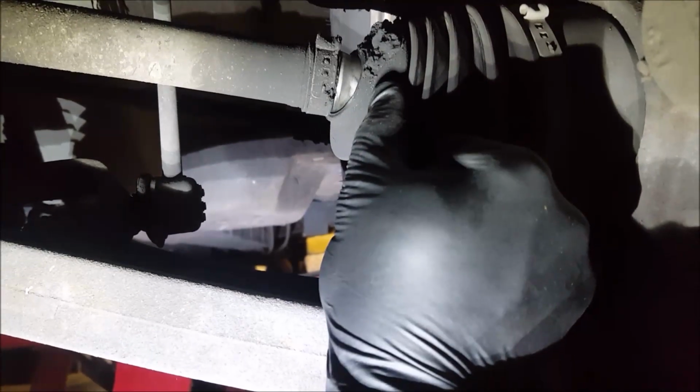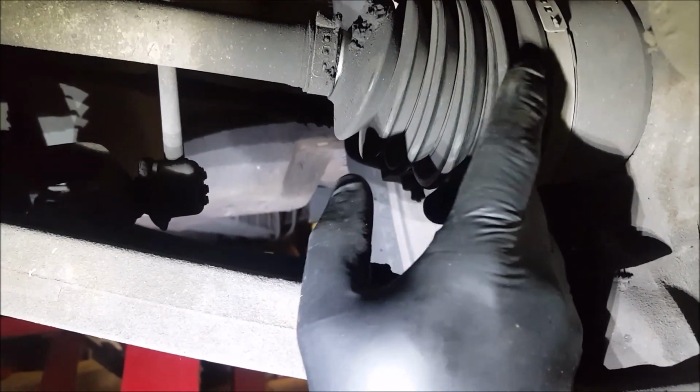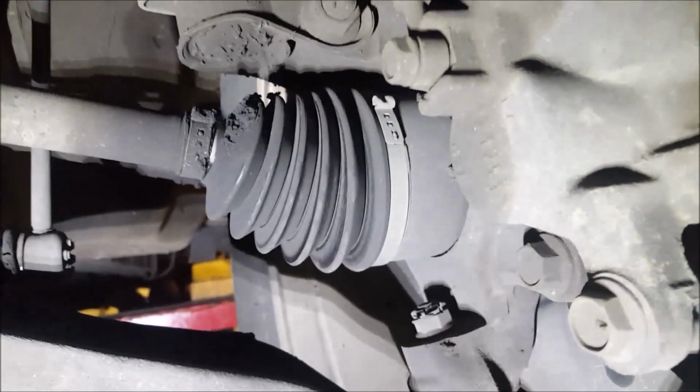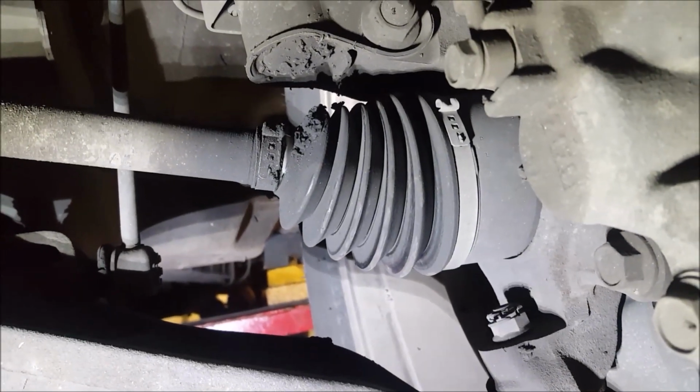As you can see here, this one's split right there. They can also split in any area in this boot. This one just split on the end. If you also look on our inboard joint here, it's leaking as well. So we are going to be replacing that joint in our next video.